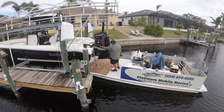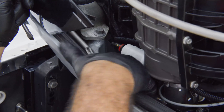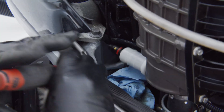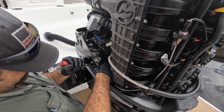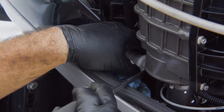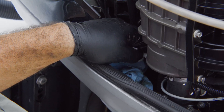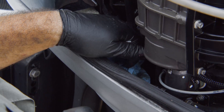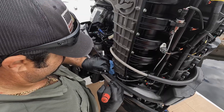Let's hit this filter. Have a little catch for the fuel — don't be shy on the paper towels. There's a little red clip to release both sides of the filter. Press it in with a flathead, push it in, and then once you get it in just try to push it off. Sometimes it sticks, but once you start to move it, it's gonna pop off. Push that one and move it out, and as soon as it pops out, put your thumb over it so we can try to catch as much of the fuel as possible. Then pull it out and hold your thumb on there.